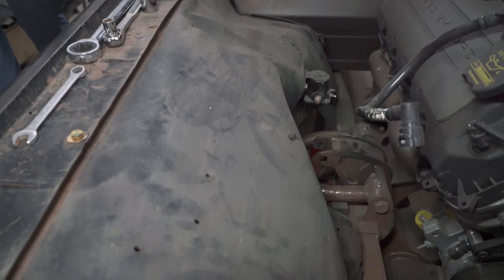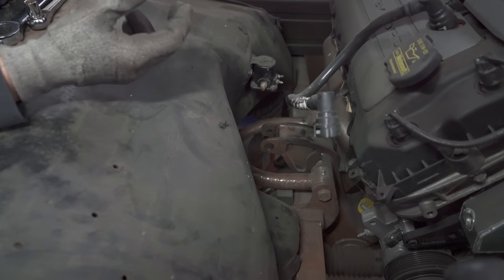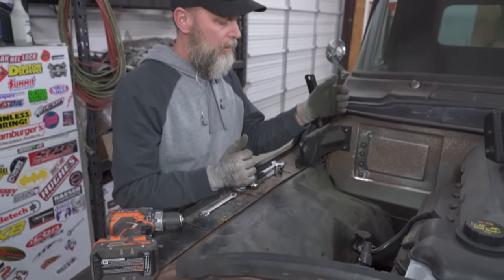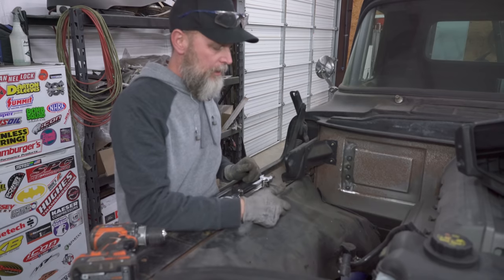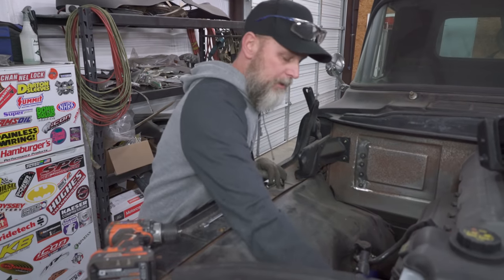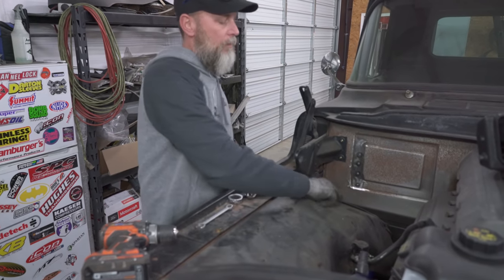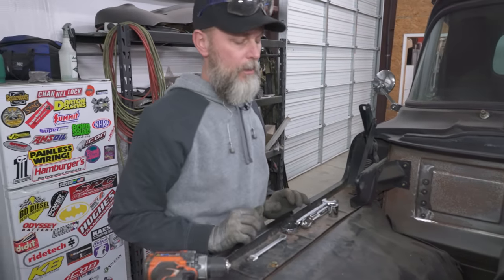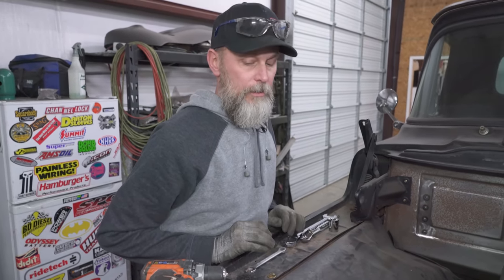As you guys can see, this inner fender here is kind of crumpled in. Full compressed, we pulled a coilover out so we can send the tire all the way up, and go full lock to lock. The tire starts to hit a little below the flat part of the fender, and then pretty much anything and everything in here and way back here. So we started cutting out all the material till it cleared, because originally we wanted to use as much of the original fender well as possible, just for simplicity.